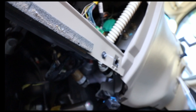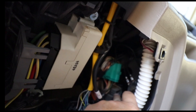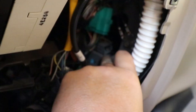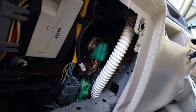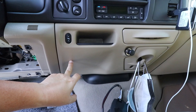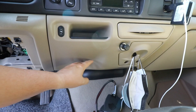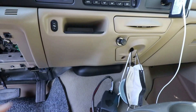I started looking around a little bit more and went back to their instructions. Right in there, hopefully you guys can see that, there's a little gray pin connector and it looks like it matches the pin connector that came on the unit itself. The instructions said it could be near the steering column or under the dash near the center console, and sure enough, there's that pin connector. If you're looking at the Excursion, that pin connector is right about right here — so the actual unit is actually going to install right there.